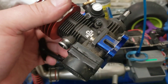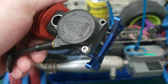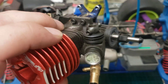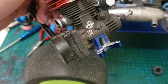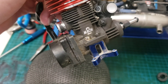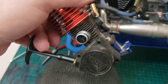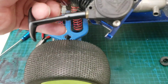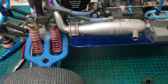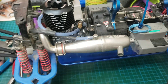As most of you know, I had the Dynamite 19 Mach 2 — 19, whatever you want to call it. It's a fantastic little engine, makes really good power and stuff, but for some reason this thing just keeps eating back plates and starter shafts. It'll run awesome for like three or four tanks, start to run really lean, won't tune, and then it's all over the damn place. You pull the back cover off and there's a bunch of slop — I'm talking you grab the starter shaft and it's literally puking and falling apart.